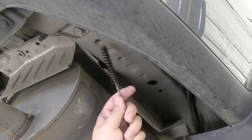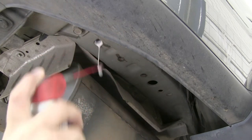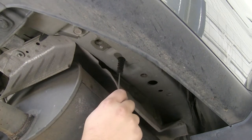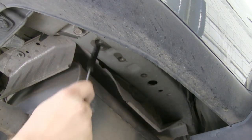Before putting the hitch into position, we'll clean out the exposed weld nuts on the passenger side as well as behind the bumper. First we'll spray them down with some lubricant and then use a wire brush, like part number 814092, to clear up the dirt and debris. We would also have to do this for the driver side, but the tow hook used the existing weld nuts, so they should be clean and ready for the install.